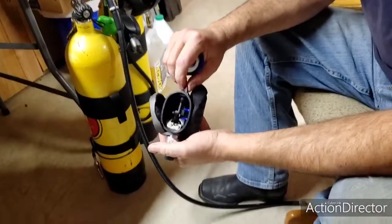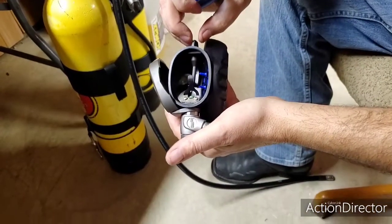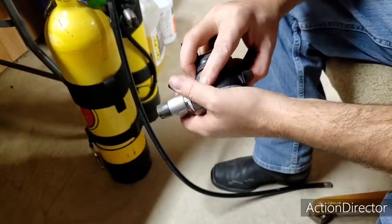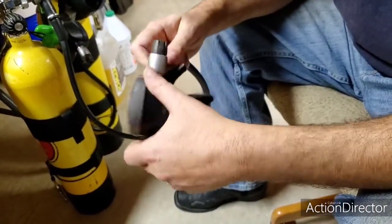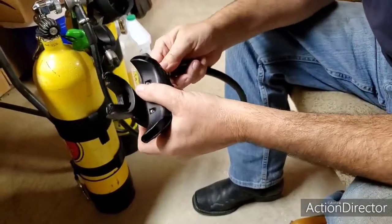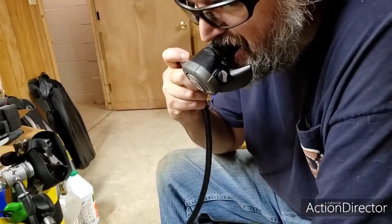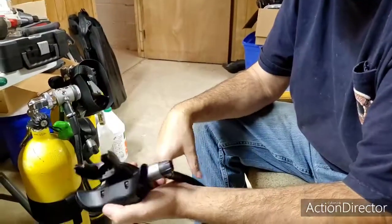Before I test it, turn the lever — make sure it turns the fins. Not sure exactly how that helps in there, but they're supposed to hit the fins, bring them over, keep everything tighter and in. Make sure that's seated in there nice. Put the cap on. If you're testing, you don't really have to torque this. Air it up — no leaks. And she's breathing like she's supposed to. That's all there is to it.